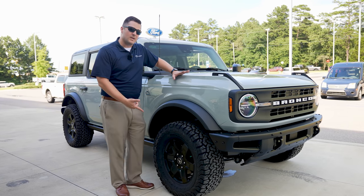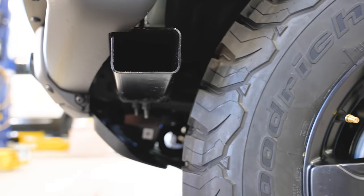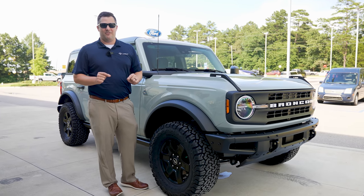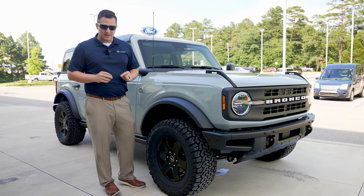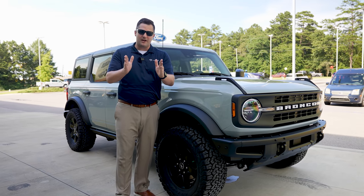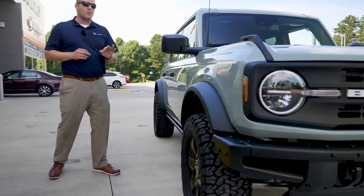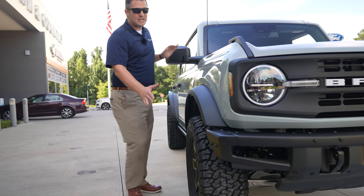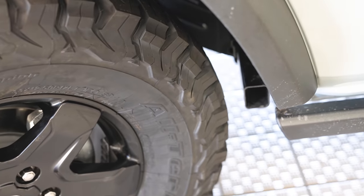We were concerned about the offset, so the wheel is a 17x7.5 — 17 inches in diameter and only seven and a half inches wide — with a positive 55mm offset. That's why you see so much bulge on the tire itself: the wheel is much narrower than the 12.5-inch tire. But what's crazy is there's no rubbing or clearance issues, even though we've maintained the crash bar in the front and the rear as well.